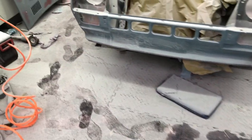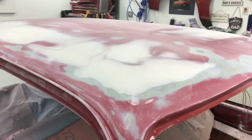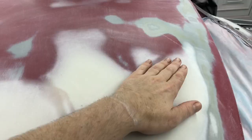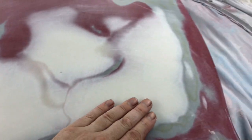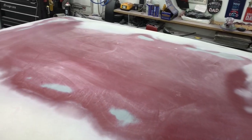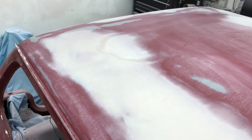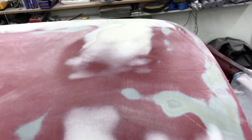Here's a quick view of my garage at the moment. The filling work's almost done on the roof — smooth into all the corners. You can see it's not as thick as it looks; it is just a really, really thin skin. What I'm going to do is apply some high build primer and then rub that down with 240 grit, or maybe even 400 grit, and then I'll leave it for a while to settle, just to make sure I get no sagging marks.